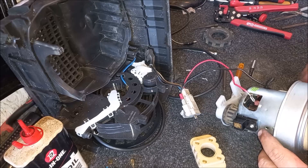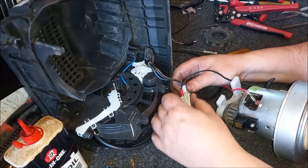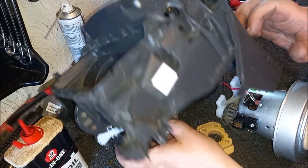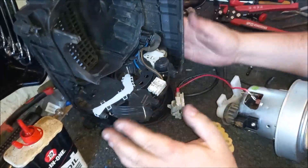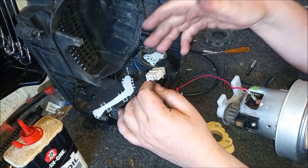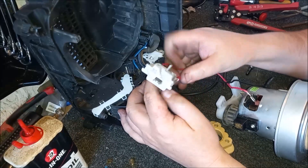This is quite interesting. I kind of had an idea in my mind in the last video and it all came down to the Miele's electronics. Let me change you around a bit so you can see what I've got on the bench. Look at that - a motor wired up to the Miele. So this is the cover for the C3 which has a connector coming out of it. This connector basically is a feed from the controls at the top. You've got the plus and minus, up and down power regulator. That board up there doesn't do very much - it just sends electricity down to the motor with a signal that needs to be interpreted by some electronics. And the electronics for the speed controller actually reside in this little box here. You can see the triac there.